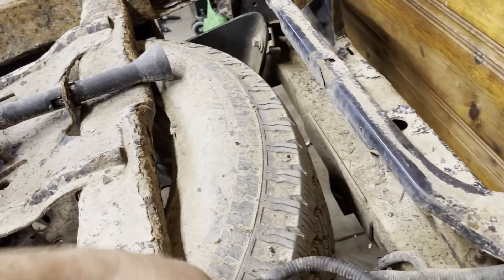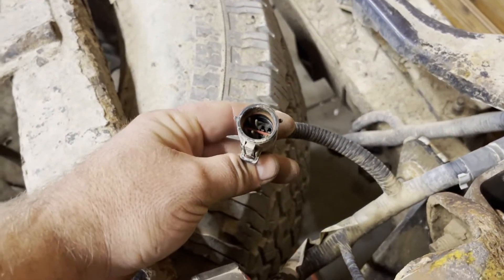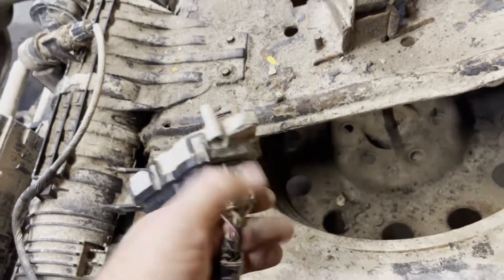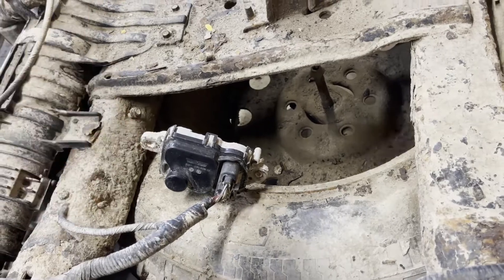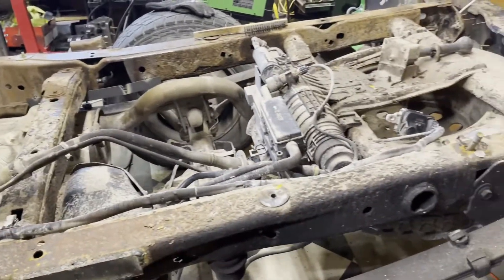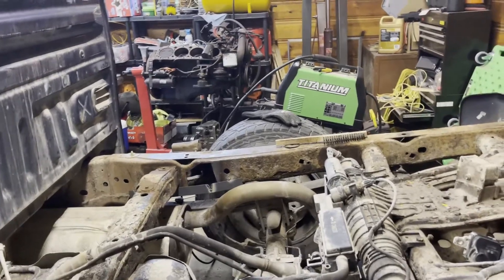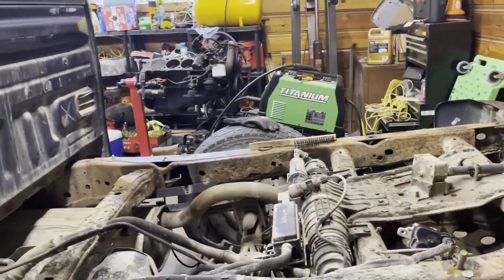This connector here does not need to be undone. This one for the tail lights does have to be undone. On this 2004 model you have a fuel pump relay attached to the bottom of the bed — if you want to move this truck you've got to take that off and plug it back in, but you have to unplug it to lift the bed off. This one had a bracket on each side also bolted to the bed that I had to take off. Other than that: undo that connector, take the six bolts out, take these front two connectors off, and the bed should lift off. It'll take a few people — it's not light. I think we did it with me, my 15-year-old son, my wife, and my 14-year-old son.